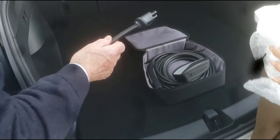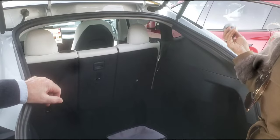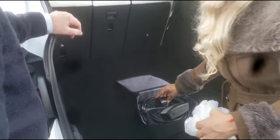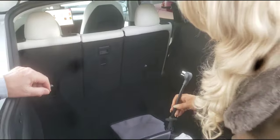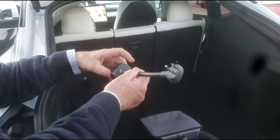Not all non-Tesla charging stations allow Teslas, so that adapter lets you charge there while they can't charge at Tesla stations. The 220V upgrade plug is $45 online — it's the washer-dryer style connector — but you do need an electrician to install the outlet. You can interchange them depending on where you are, like an Airbnb. The 110V plug comes included, and the 220V adapter is just this piece without the 110 adapter — you plug it in the same port.